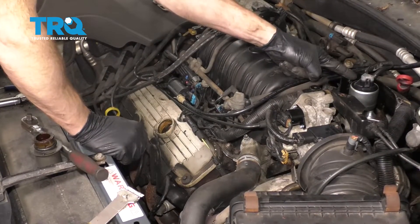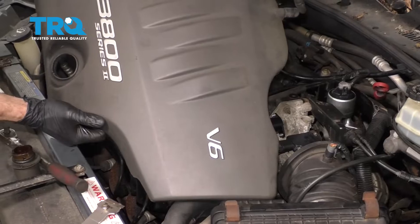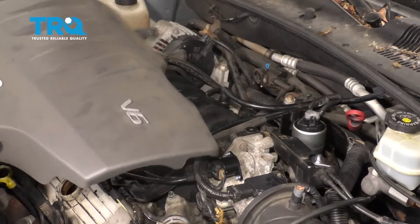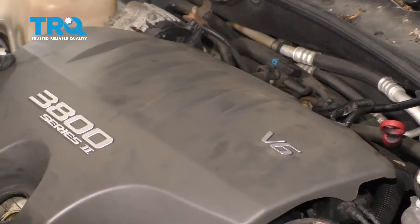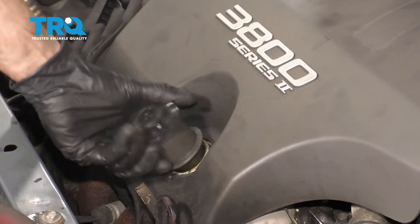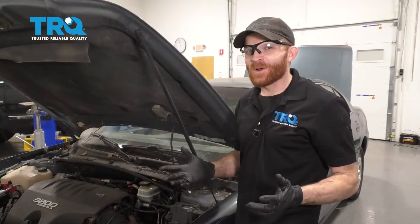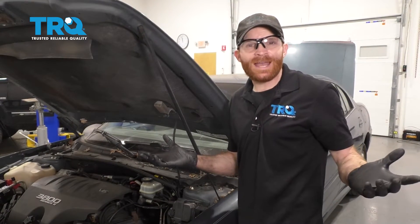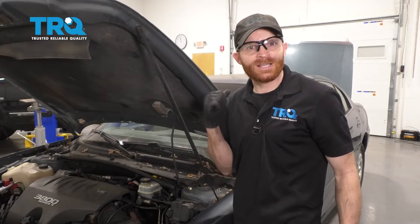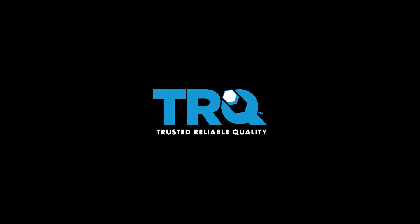Let's give everything a final look real quick. Make sure it's plugged in and of course it's torqued. After that, we can go ahead and put on our engine cover. Looking at the backside, you can see this nub that protrudes — it needs to fit into this area right along the back. Go ahead and slide that right in there. As you do that, bring the front down, start lining that up as well. Go ahead and put on that fill, turn it clockwise until it's completely locked in. We got our EGR valve in there. Typically, you're gonna wanna go ahead and start up the vehicle, let it run for a little while. Make sure you don't have a check engine light. Assuming that's good, shut the hood and take it for a road test. Thanks for watching.